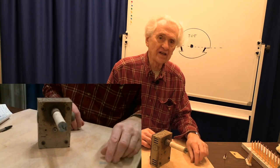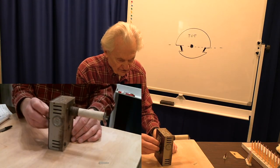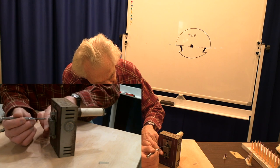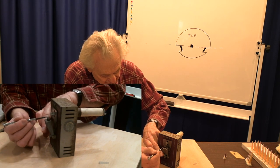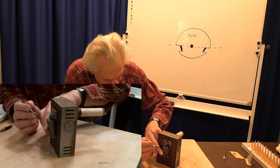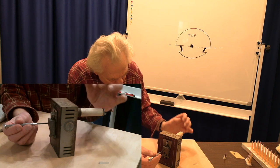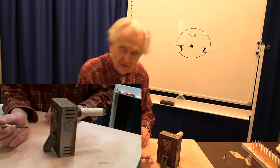With the gauge in place, on the outside there's a little set screw in this weighted arm that I can loosen. If I loosen that, I can raise and lower this blade. With the arm held in this position, I want to raise it up so that it's just grazing the bottom of the hook, which means that's where it will release. I take a little screwdriver, loosen this set screw enough to raise the blade up and down to where it just grazes the bottom of the hook — meaning when the hook goes up just a fraction of an inch more, it will not catch the blade anymore and it'll drop and release it.